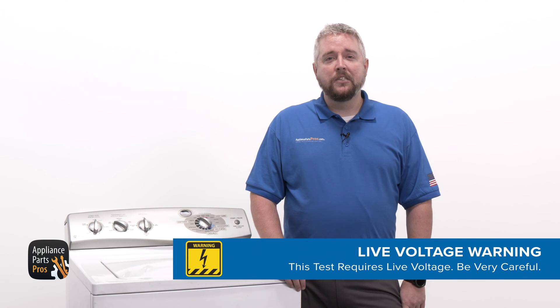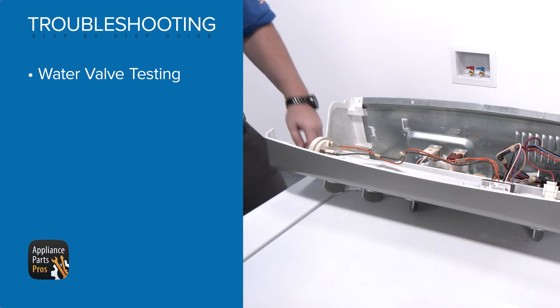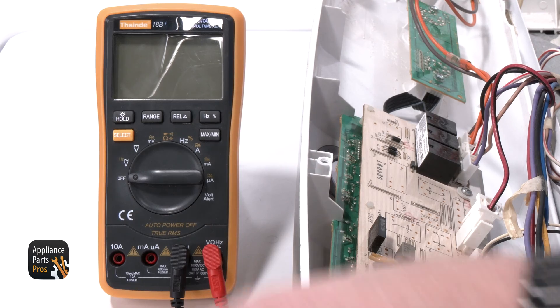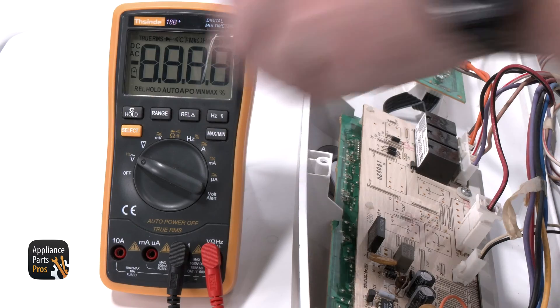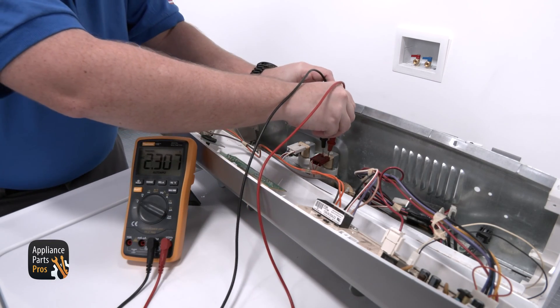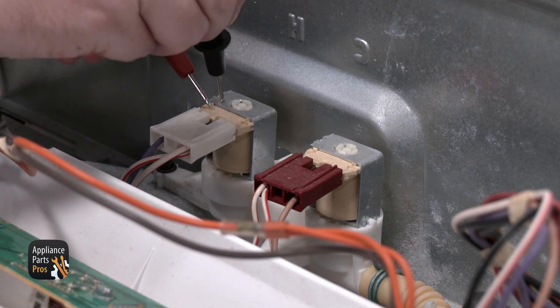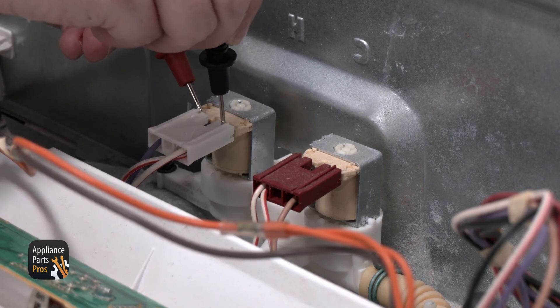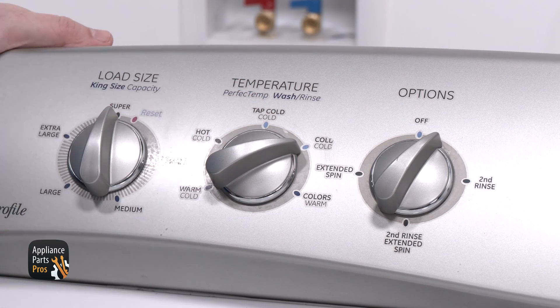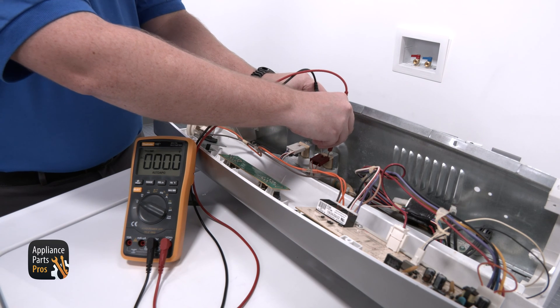Please don't ever test live voltage if you're uncomfortable using a multimeter. To see if the water valve is good, we need to check for proper voltage. First, set your multimeter to test for AC voltage — it'll have a symbol that looks like a V with a squiggly line. Then check the wires going to the cold water solenoid, and then the wires going to the hot water solenoid. You'll need to set the temperature to the appropriate setting depending on which solenoid you test. You should get a reading of 120 volts during each test.